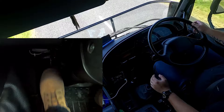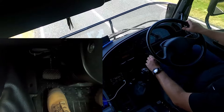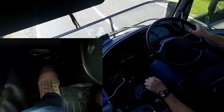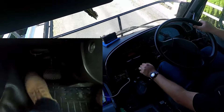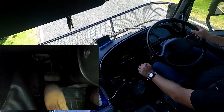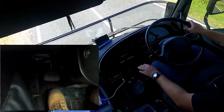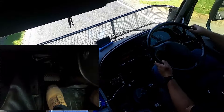With downshifting, you're going to go clutch to neutral, give it some revs, then clutch to gear. Just a little rev-match. So it's: clutch to neutral, some revs, clutch to gear. Each truck is different — probably around 100 revs in this truck, some might need 400 or 500 revs. But you're effectively rev-matching. Important to remember the clutch has to be out when you're doing that rev: clutch to neutral, revs with the clutch out, clutch to gear. It's just matching the gearbox up with the motor speed.